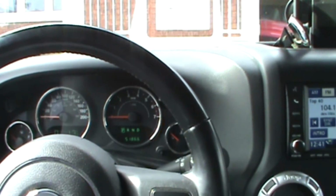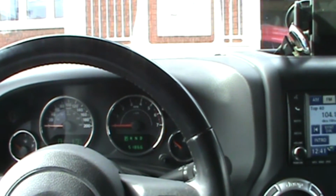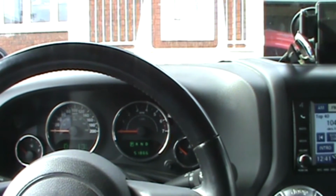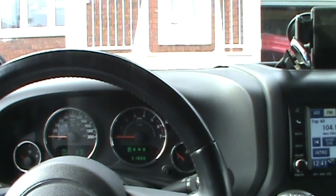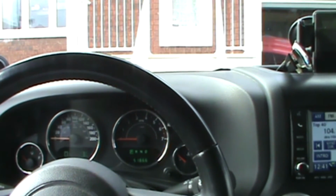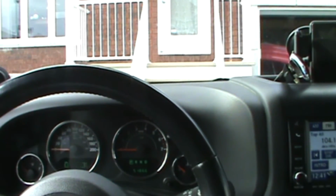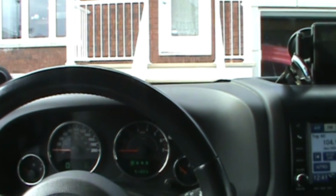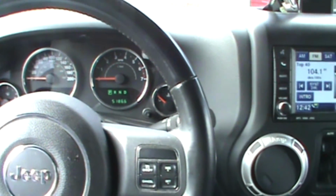So if you change any parts, you're disconnecting any steering or replacing parts, like the tie rod, front axle, or anything like that, this can cause this module to become out of correlation with the wheels. So to center the wheels with the steering wheel, the ProCal chip will indicate to the user exactly where the zero is on your steering wheel, basically on the sensor itself. So when you're enabling the steering sensor mode with the ProCal module, you'll see the corresponding turn signal light go on in the dash, whether it's the left turn signal or the right one, depending on how far you are from the center. So I'll show you more about this.